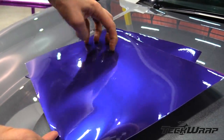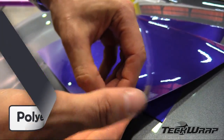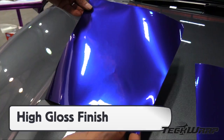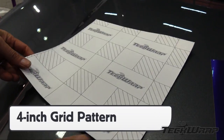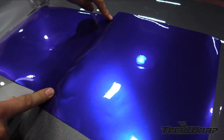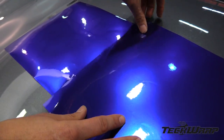If there are any scratches on the surface of the wrap film, this is no cause for alarm. The Gloss Metallic Series has a clear liner that protects the wrap film from scratches during production. The finish is high gloss metallic, which means it has extra sheen. The liner has a 4-inch grid pattern on the back, which can aid in production and direction. Keep in mind that it is not directional in spite of being a metallic film, which helps reduce mistakes during installation.